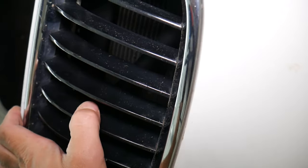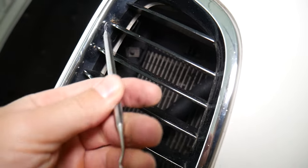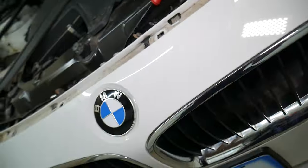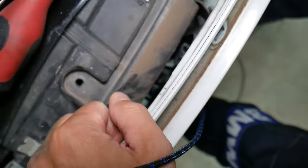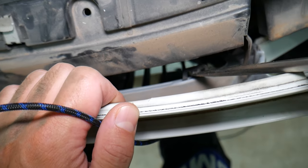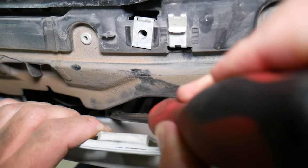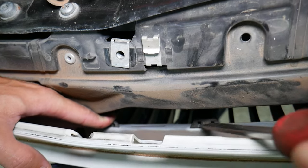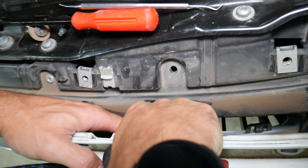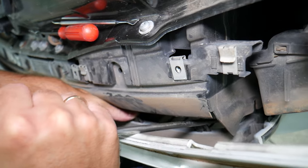You can access the kidneys and some of the clips from the back side. Let's show you what we have here specifically. If you look, you're going to see the clips — on top you have three of them. Some people will try to get them from the outside without removing the bumper, and you can play the clip that way — but when you remove the bumper it's way easier. Those are the clips right here. We're going to push that middle part. Do one at a time, starting on the inside. It's not easy, and there are so many clips holding that grill.